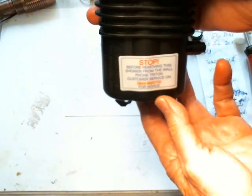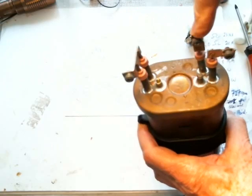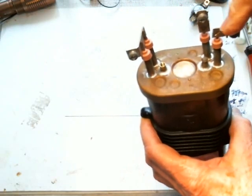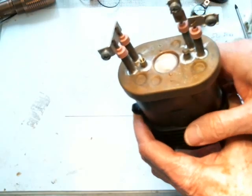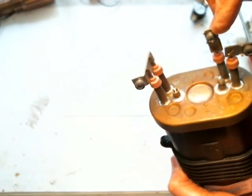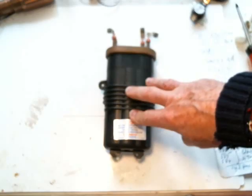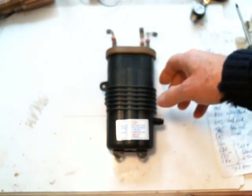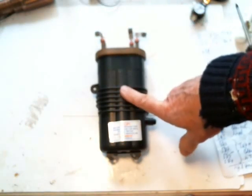So I think that's the mode of failure. When you take this out, measure the ohmic resistance between the terminals - this particular one had a resistance of about 10, 10.1, and 12 ohms, and that's where you get your two heating coils. Obviously if you can't get an ohmic resistance between any of these connections, the boiler's duff and you might as well throw it away. If you replace one of these it costs about 50 to 60 quid, so really that's the end of the life of the whole shower - you might as well chuck it all and start again. A new one is about 100 quid.